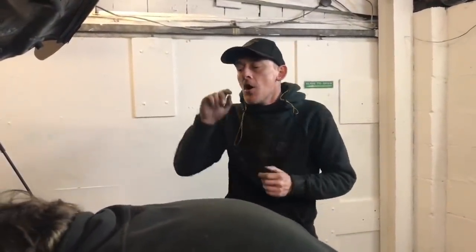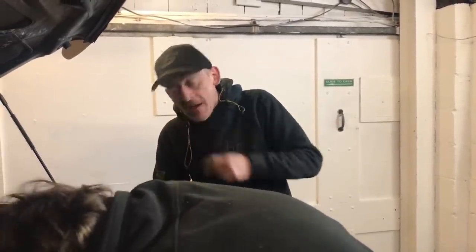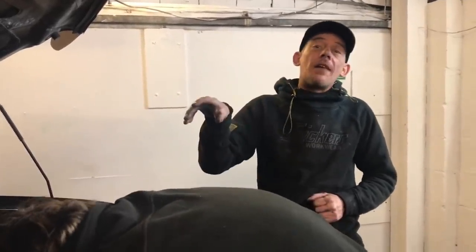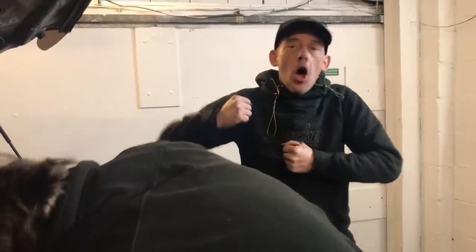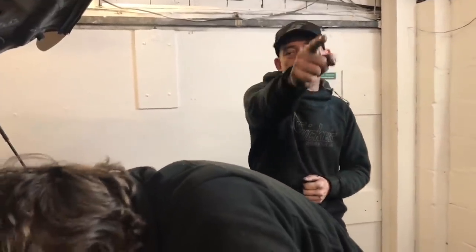Go on, Snap-on. Right, because this job today is all about speed, just remember guys, that bolt is very, very tight. Sometimes you have to pull the starter motor out and use a big bar to lock it, and then it's a normal right-hand thread. So it's left for loosey, right for tighty. Top tip for you guys.